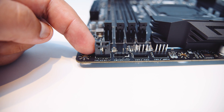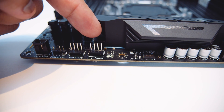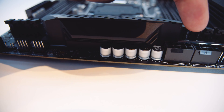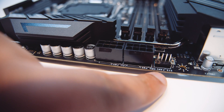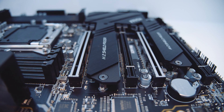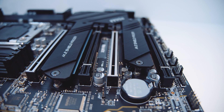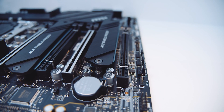There's a USB 3.2 right-angle header, a USB Type-C header, and another regular USB 3.2 header, plus a 24-pin power connector. Next to the 24-pin power connector is a stack of LEDs to help diagnose issues — MSI calls it the Easy Debug LED. There's also a Corsair RGB header, another 3-pin 5-volt addressable RGB header, a CPU fan PWM connector, and an AIO pump connector. Moving to the other side of the board, there are two 8-pin EPS power connectors for the 10980XE. There are four PCIe slots: the top is x16, second is x8, third is x16, and the bottom is x8, with SLI and Crossfire support.